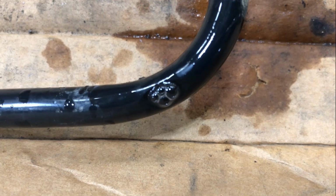The other thing that we sometimes see on Chrysler Dodge Jeep Ram small evap codes that are hard to trace down is a crack at the fuel pump module plastic on top of the tank. Sometimes that happens, but it's really rare for us to see plastic tanks causing evap leaks. And it's getting pretty rare to see anything on top of the tank causing a leak until it gets 10 years or older. Then that plastic starts rotting, or rodents. But this one, I smoke tested it and nothing came about.